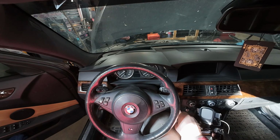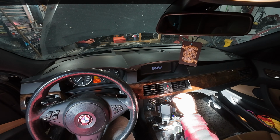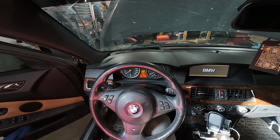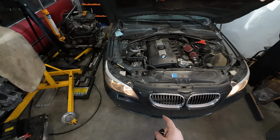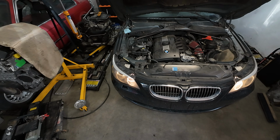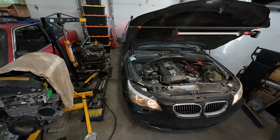So we're going to hold our foot on the throttle, two clicks. Now make sure that the fan speed is as low as it can go and the temperature is the highest. You can probably hear that the thermostat is going. Ignore all the faults and the blinking lights. That's a whole other issue. But you can hear the water pump ramp up. You can hear it at first, and then usually it goes for a bit of a break, and there you go. So far it does sound like the water pump is okay, so I think that's at least going to be going for him.